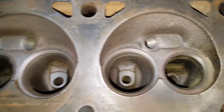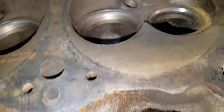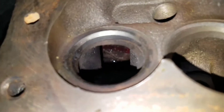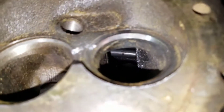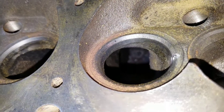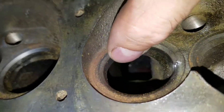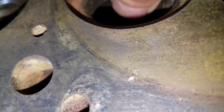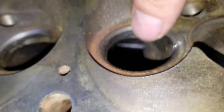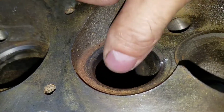So we're going to work on that — I'll show you how to port them. I'm also going to show you why they suck a little bit. Look at that exhaust seat — it's like a lip. Flat, as you can see, and a lip. It does not come out or protrude at all like a 675 head would. You lay this back and there's no throat — there's just nothing there at that point.